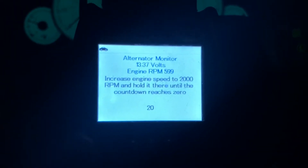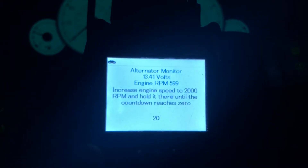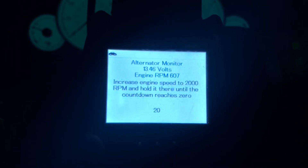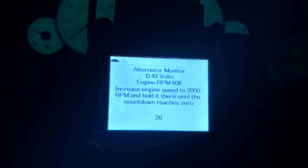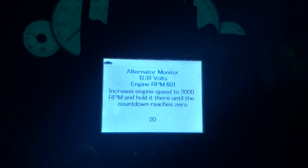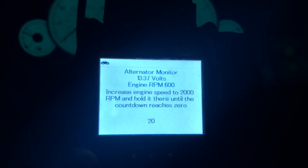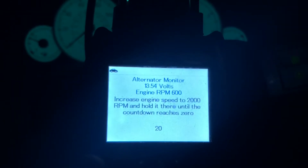I think this is actually very nice — it's considered fixed. If your alternator is not behaving, consider replacing the brushes. It's very cheap. If you have a slightly bigger budget, pick up the brushes and voltage regulator as a set — it'll cost about $40 instead of $20, and you'll have a better chance of fixing it in one go. It's just two more bolts to get the voltage regulator replaced.